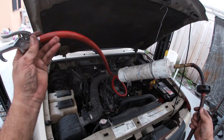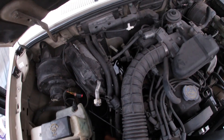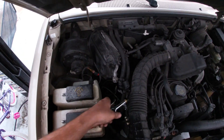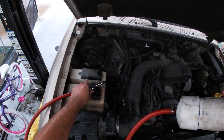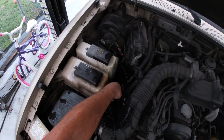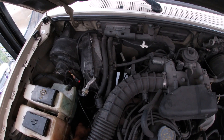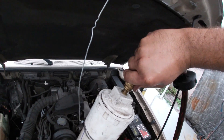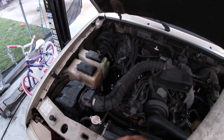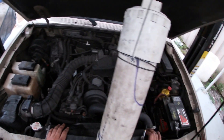It's probably hard for you guys to see that one, but I'm gonna go ahead and hit it here at the evaporator again - this time I'm gonna do it the other way. You want to be careful that you're not facing the general direction of the hose, because then you're gonna get sprayed. Okay, that takes care of that. But we're not done because we have to get all that residual alcohol out of there, so to do that we're gonna use plenty of compressed air.